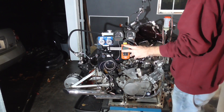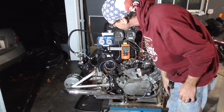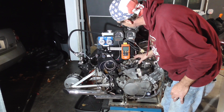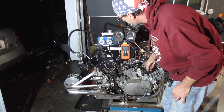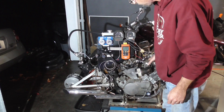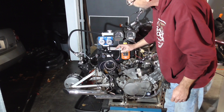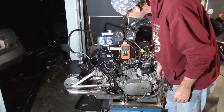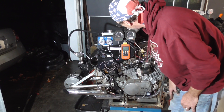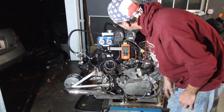When I tried to rev it up, that back cylinder went so lean it just stopped running — you saw 22, so it wasn't even firing. The front was trying to kick on, but the imbalance in the two cylinders is going to be really hard to control with this carburetor. A carburetor running stock jets, just like the duals, is not capable of running these cylinders rich enough. Just to get it running long enough to get measurements, I was having to have the choke all the way over, feeding it extra fuel, and the mix needle opened up to about six turns. We're going to have to rejet this carburetor to get enough fuel to do proper testing.